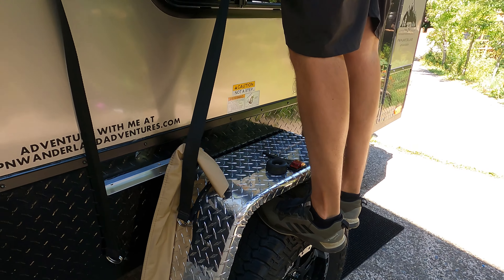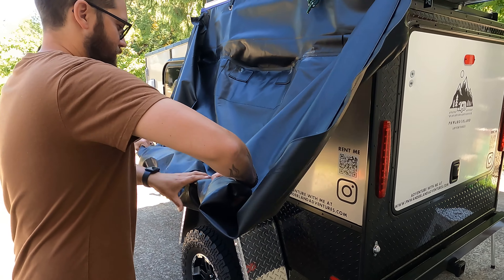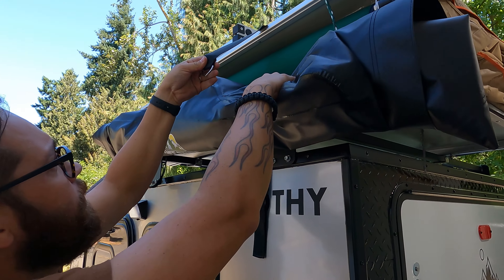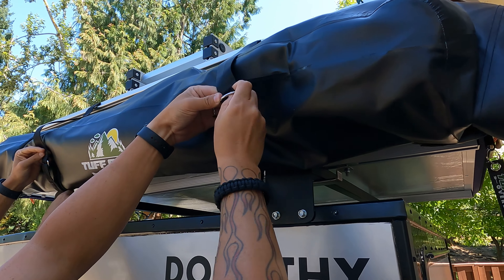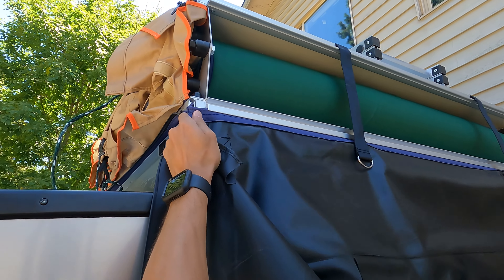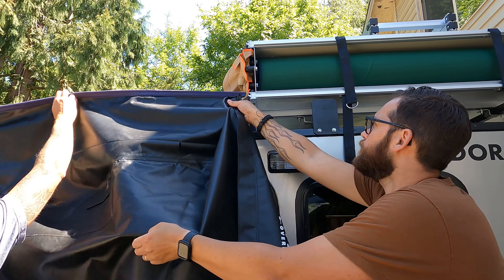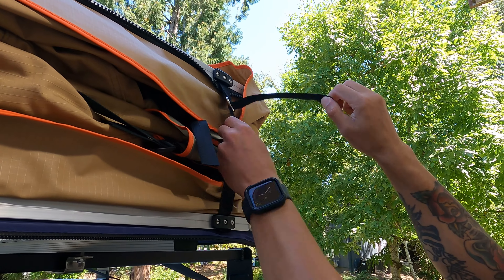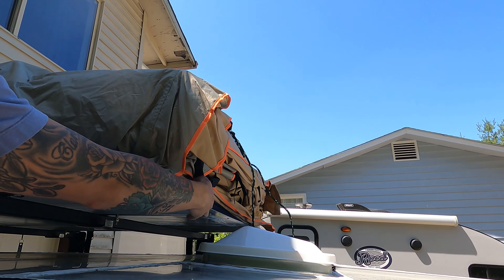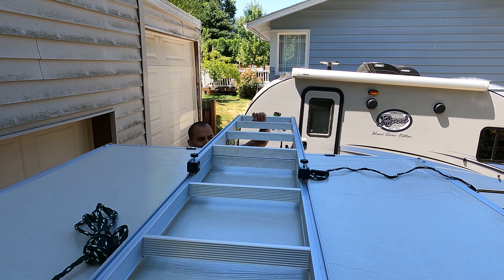The top of the tire can also be used to get up there and grab what you need. Once the road cover is completely free, it can be rolled up and secured with the straps on the back of the tent — or it can be removed completely by sliding the blue end out of the channel. If you're going to use the added annex room, the road cover has to be removed this way. There is one velcro strap on either side holding the rooftop tent closed. Slide the ladder into its open and locked position — you'll hear a click when it gets to the end.